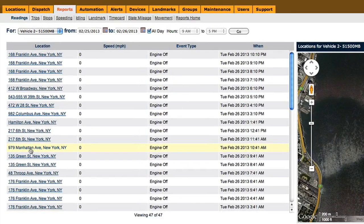Although this was covered earlier, let's go over basic troubleshooting for this again. If you have the VFS wired, ensure that the ignition wire is secure and only getting exactly 12 volts when the engine turns on and no power when the engine's off. If you have the VFS plug, please test the device in another working vehicle or another working device in this vehicle. If you're still having issues after checking these, please contact client support.